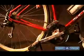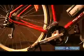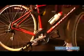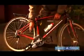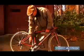They don't have to be alloy steels because the parts are so thin, so that you can make them out of just carbon steel with enough carbon in it. And when you quench them, you can quench them fast enough to harden them because they're so small. So you don't need alloy steel in the chain.